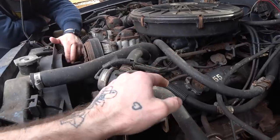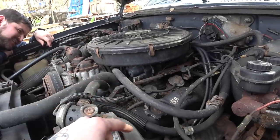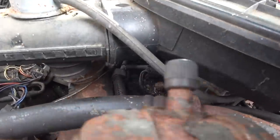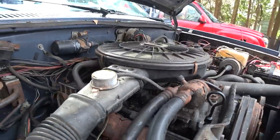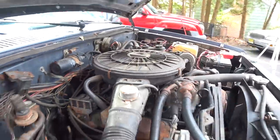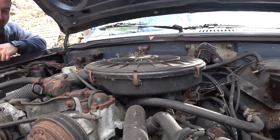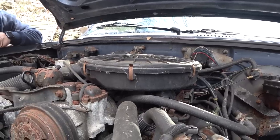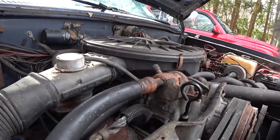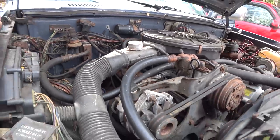Here's another thing: once I get this thing out you can turn these carbureted, but it's harder because they need a different cam. My understanding is they don't make a vacuum-advance distributor that will work with the cam in this. Wait - what's that? That looks like a TPS from a 4-liter! That is exactly what it looks like. Can you guys see in there? Better view from over here - that looks exactly like the TPS from a 4-liter. But that wouldn't make sense because this was designed before Jeep... although I guess the 4-liter existed by '87. At some point I'm pulling that TPS sensor - I'm going to put it in my Jeep and see what happens, because it'll definitely bolt up and the connector would connect. That's pretty funny.